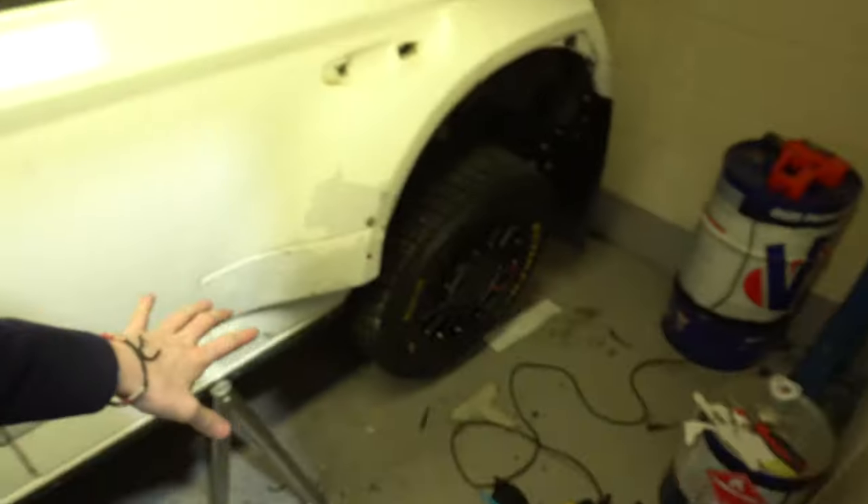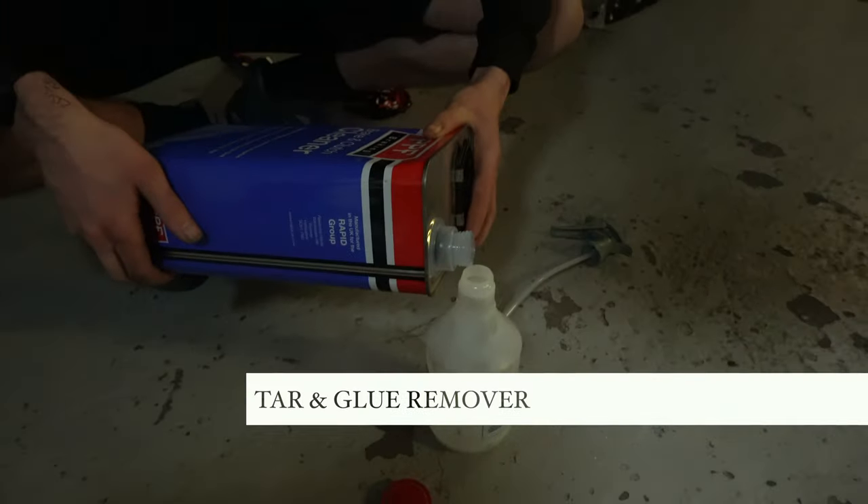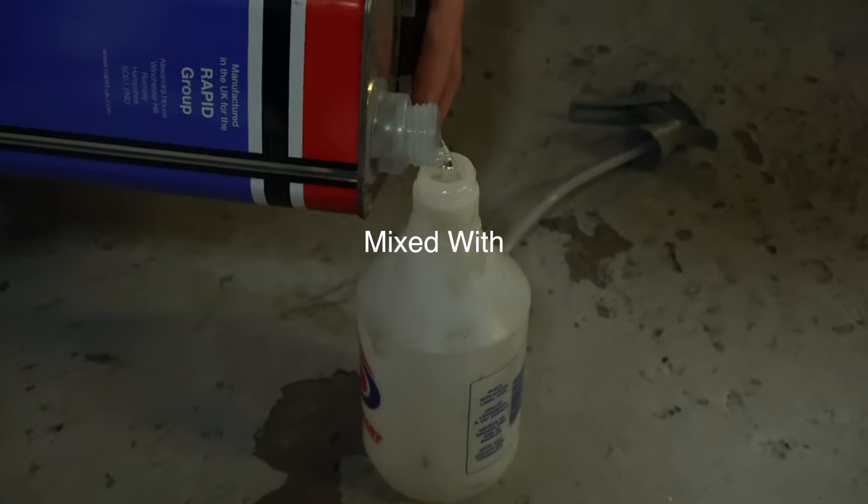I have put this car through a bit of stress over the year and it is feeling the pain. On a positive note, there are areas like the roof where we used the technique of heating up and pulling the vinyl off and it's worked perfectly without leaving anything behind. Now the last thing to do is get some of this adhesive off — to finish it off we need a bit of tar and glue remover. Look at that — perfection.